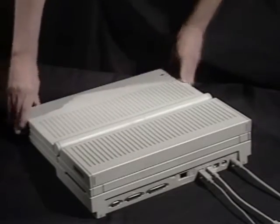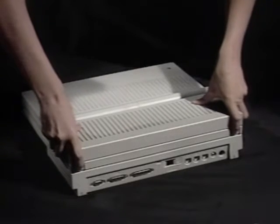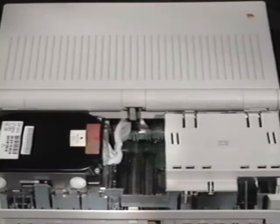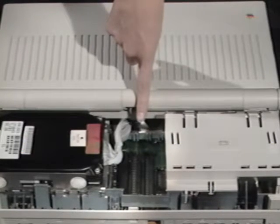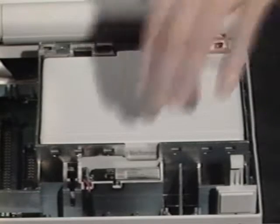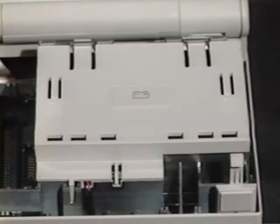Close the Portable and disconnect the peripheral cables. Remove the rear cover by pressing the two buttons on the back side of the case, pull up back-first, and lift the cover away. Touch something metal to discharge static electricity. You should see the hard drive, the expansion sockets, and the housing for the battery. Remove the battery — the battery cover lifts off and the battery lifts straight out. It's heavier than it looks, so be careful not to drop it. Replace the battery cover over the empty housing to prevent the Mac from trying to run off the battery.